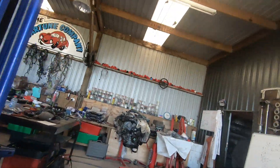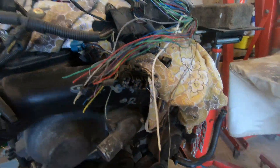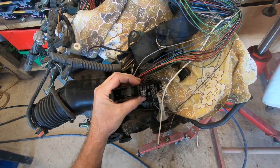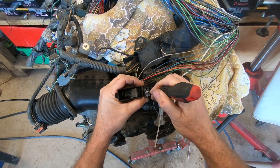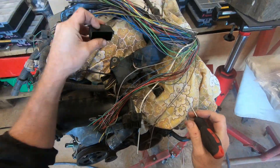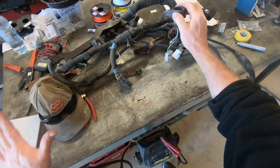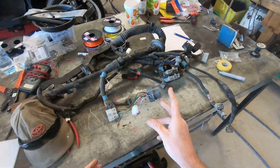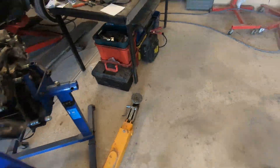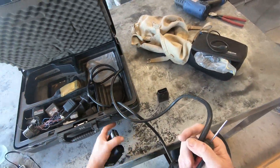We better look at the VVTi one while we're here. Here's the VVTi port — here's the lid. There's an earth, no W, no TE1, no TE2, no VF1, no VF2, there's a plus B — that's all. So you're not going to get communication with that one; those are OBD2. When I wire this loom I wire a little adapter so I can get information — I modify that so you can get some information.